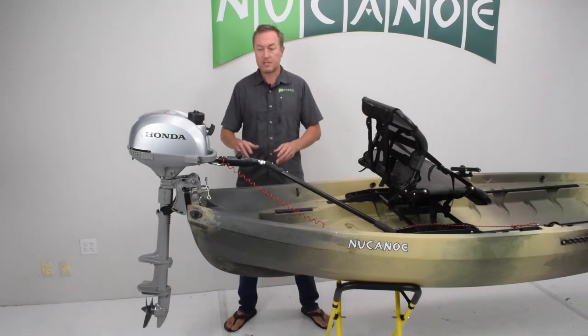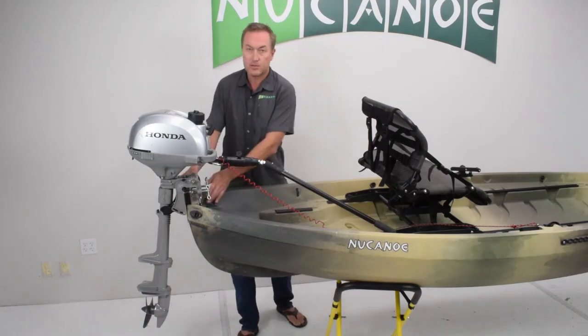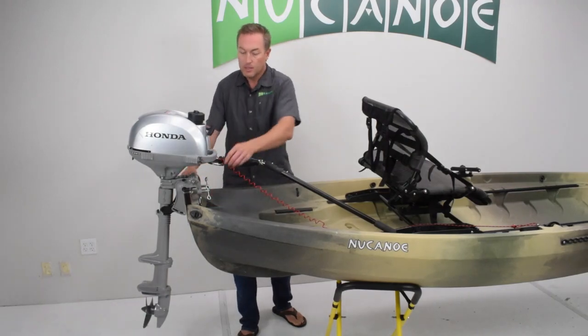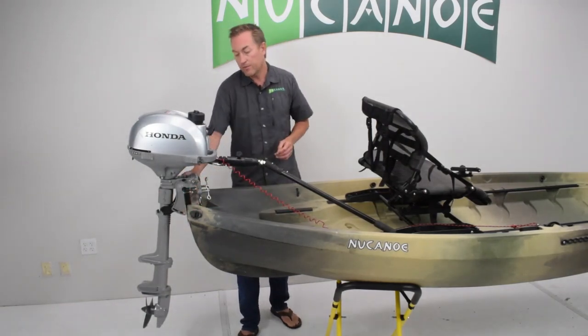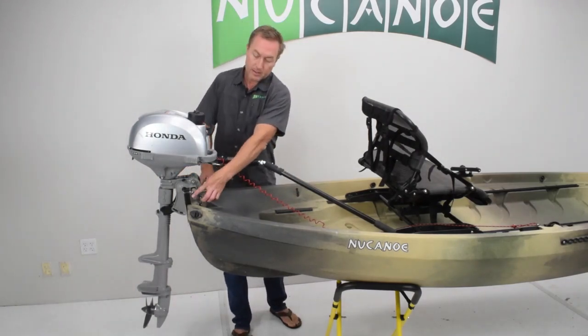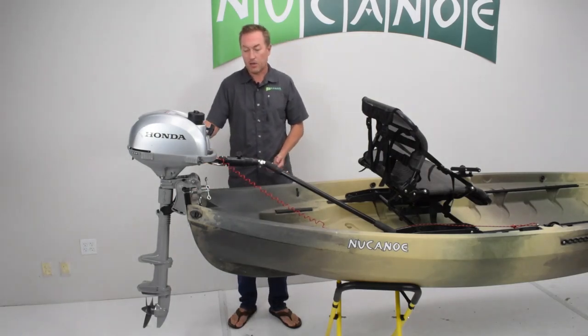Next up, we're going to cover setup and control. So the two things we definitely recommend, first is the number 7102 outboard motor bracket that's going to clamp onto the transom, give you this raised up part here that's narrower for the motor to clamp onto. It's going to protect your transom. Also has the little lip on top so the motor cannot accidentally slide up and off.